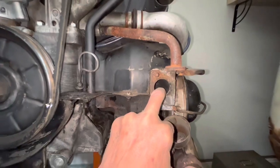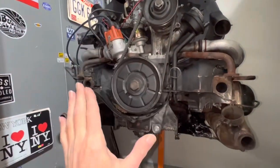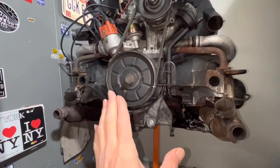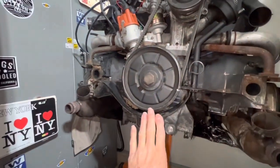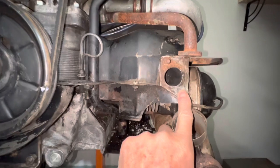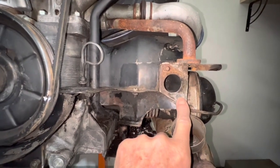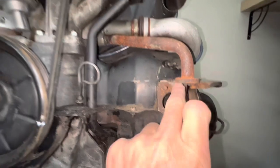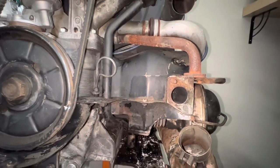I'm really impatient sometimes and I just wanted to get it done. The plan is to correct all the oil leaks in this engine, and if I'm going to open it anyway, I'm going to do an upgrade — but that's food for thought for near future projects. It's always good to have a spare engine. So what I ended up doing: I had some Permatex called Liquid Metal, and I filled that cavity right there. It's rated up to 4,500 PSI — there's no way we'll torque this to more than 20 pounds — so that should work.